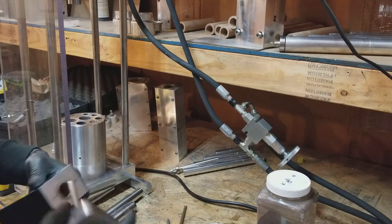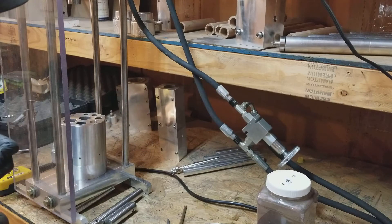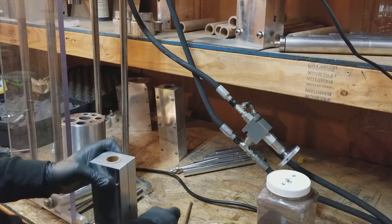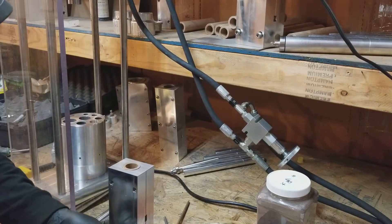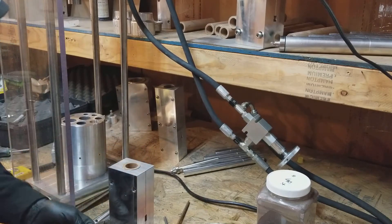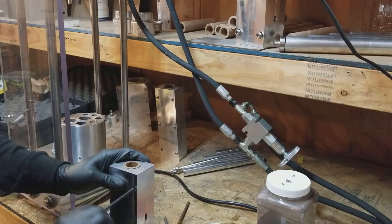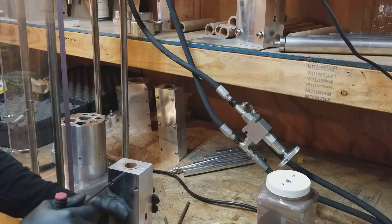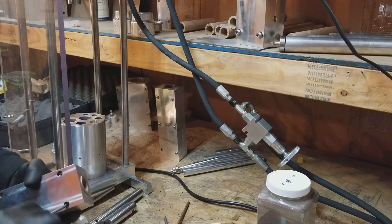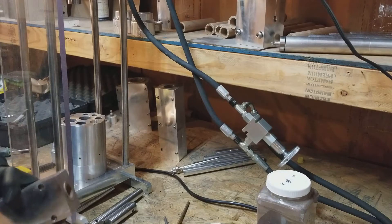I actually like it a little tight. I like it tight on the base so they can't loosen. My spindles are cut bigger at the base, so it'll hold the tube there. They're 22 thousandths over, just for that very purpose - so it'll grab the tube and the base stays on, and no fuel creeps around there.